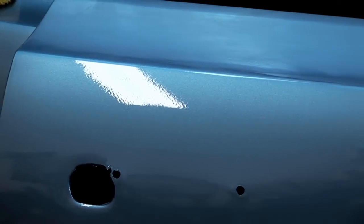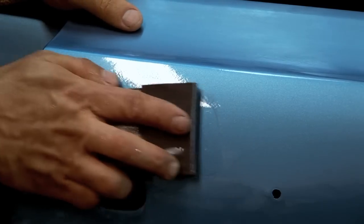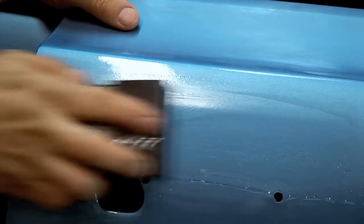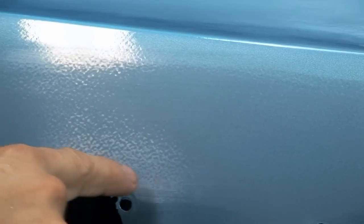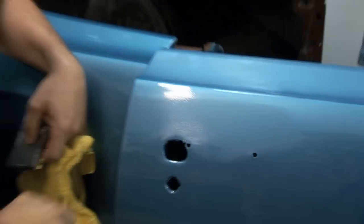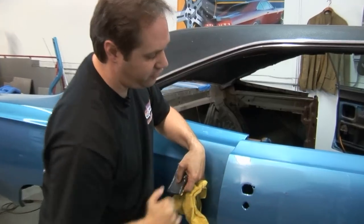I'm going to show you what it looks like when you start the sanding process. This is our right-out-of-the-gun orange peel finish — I'm going to show you those little peaks and valleys. I'm going to hit this real quickly, not applying a lot of pressure so we don't take it all off. We're going to wipe this off. Here you can see all those little shiny little dots — those are actually divots, low areas that I haven't sanded down to yet. But here we've got it — we're already getting a flat surface. My job is to make the whole car nice and flat like that.